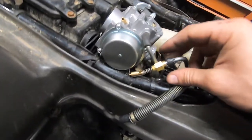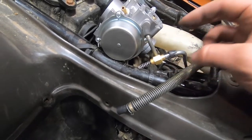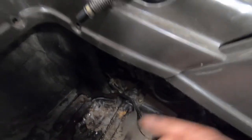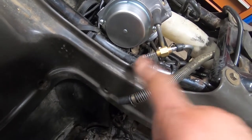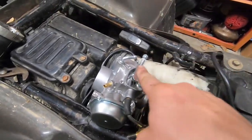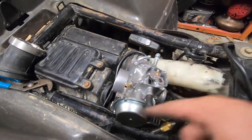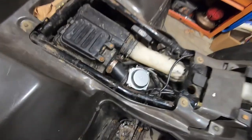So we're all adapted up here. You can see I put this rubber piece on — there's my choke plunger. I got it adapted with the spring and the plunger. We're gonna thread that in now, put our side plate on, hook up our fuel lines and stuff, and then we're gonna get ready to start it up.